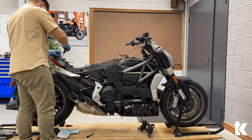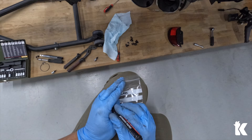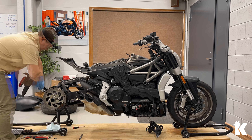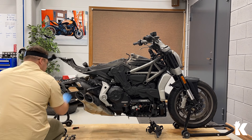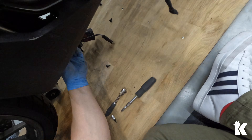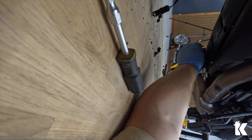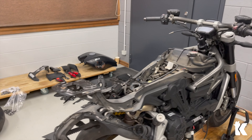Now I will loosen the rear under-seat parts, take off the lights and electronics there. Also let's remove the rear wheel — it opens up much space and it's easier to access other parts. Taking off the rear mud guard and the rear plate holder. Now let's loosen the rear suspension pressure tank to get access to some exhaust bolts. On the left side I need to remove the lower panel to access the front header nuts. There's quite a lot of dirt in the lower panel section — some nasty oil and sand mix. It's quite a tight fit, but once the header is loosened then the exhaust comes off pretty easily. It's quite a big fight with the exhaust, but finally it's removed. Exhaust, rear wheel, tank and rear end is off now.